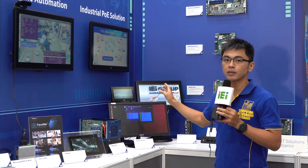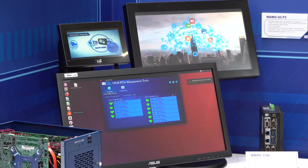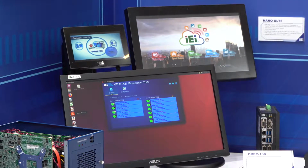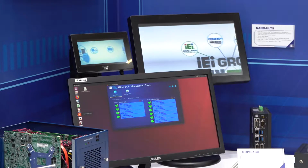This workload is run in the integrated GPU, so we can run two different demos in one machine with two different accelerators. And then is the industrial PoE solution, the AlphaLux 3 panel PC series, which is based on the Intel Apollo Lake platform. The key feature is the AlphaLux 3 series is IP64 waterproof, and it also supports the M.2 AE key for Wi-Fi installation, and M.2 BM key for storage. And the most important is the power supply is via the PoE switch. It follows the IEEE 802.3 protocol, and it can support up to 90 watt power supply.